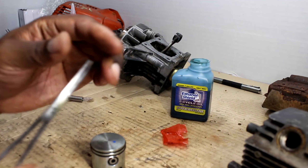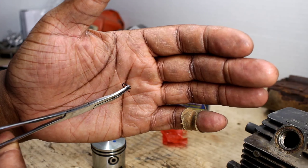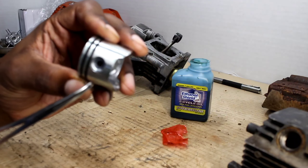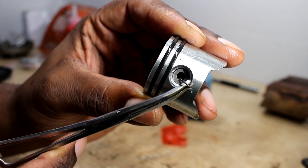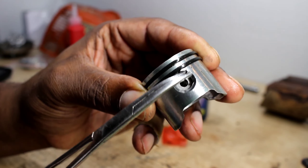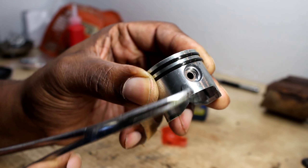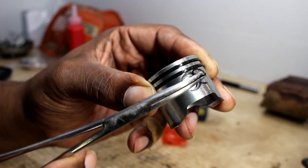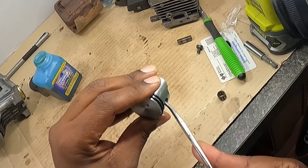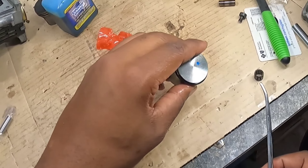I have the circlip in my pliers, and here's my piston head. What I like to do — there's a little indention right here that you can slide the pin through, and there's a little slide where the circlip can go. I'm going to do that. There's really no way to show it on camera but I can try. Boom — it snapped in like that. I got it in exactly how it's supposed to be.